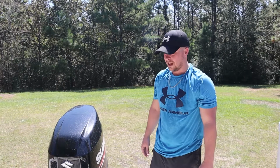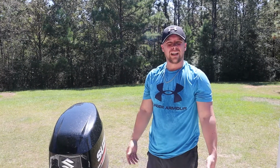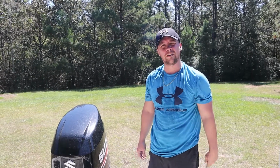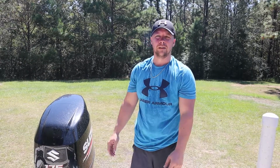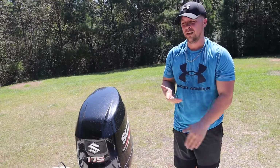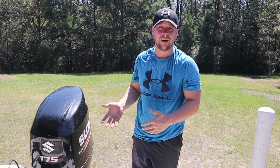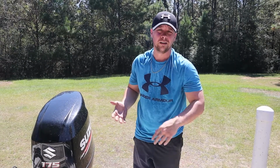Motor's running good. I'm going to sit there and let it run, let it flush out for a minute, and fingers crossed we got it done, and maybe we can actually go on a fishing trip next weekend or something. I know this wasn't a fishing video, something a little different, but sometimes it's how it goes. These things are going to break down. Really, that filter should have already been changed. I had it serviced, and apparently I didn't look at that filter, because it's probably been like that for a while. Either you're going to pay somebody to do it, or you have to do it yourself.